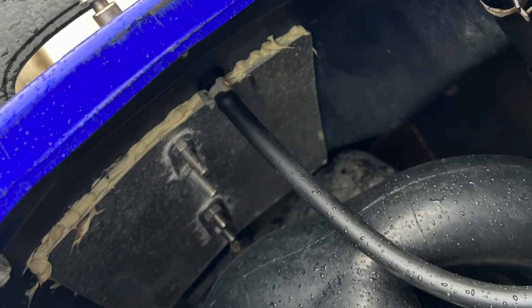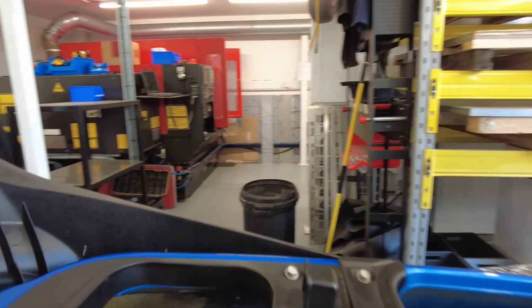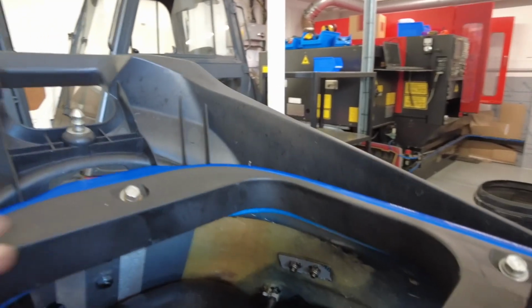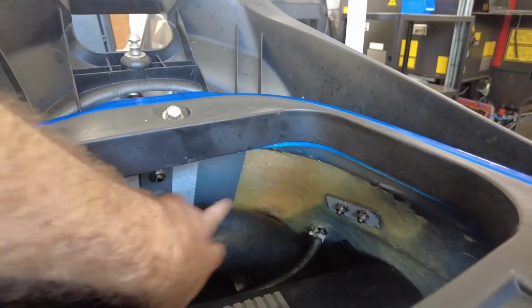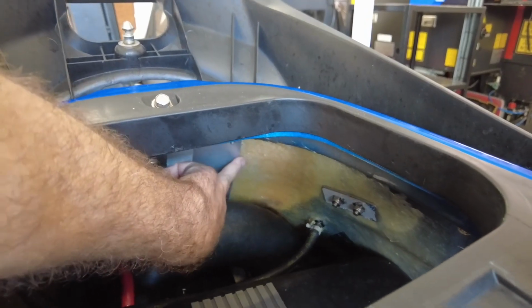I did speak to Carty, and he was talking about the reinforcement from the inside. The old ski just had a plate on the back on the inside, and he said that's probably okay if it's just for one season, but with a plate just going across the back, they've noticed it can start to stress the actual hull, where the edge of the plate sits. So they have been fiberglassing theirs. So I decided I'm just going to do it, and I will fiberglass it.